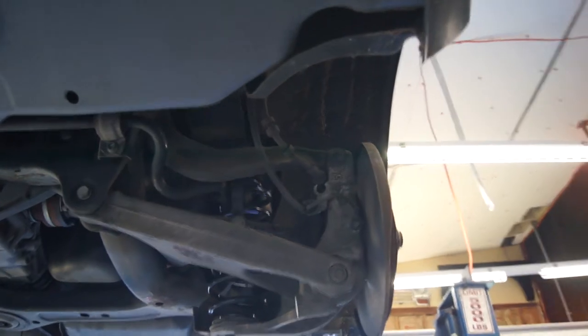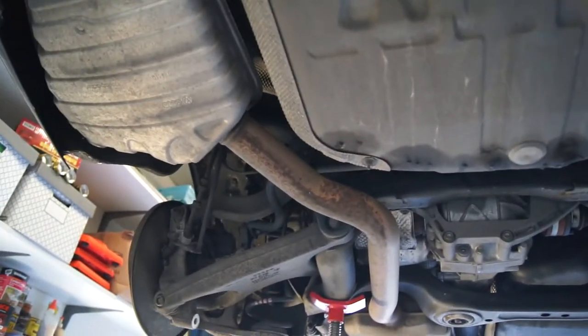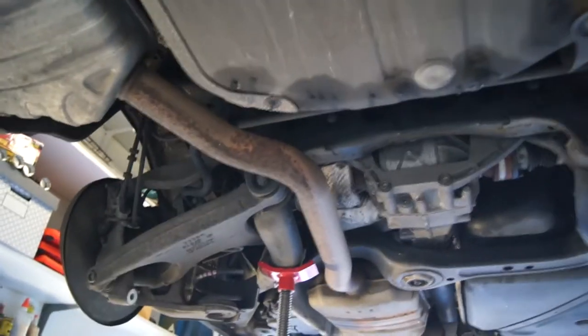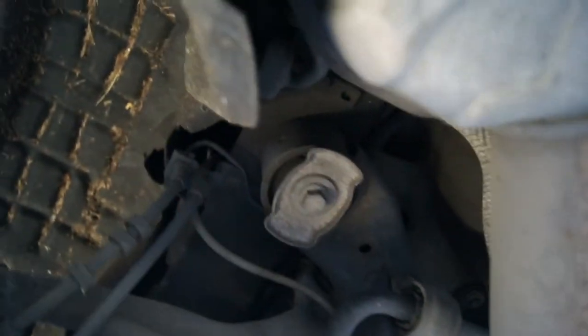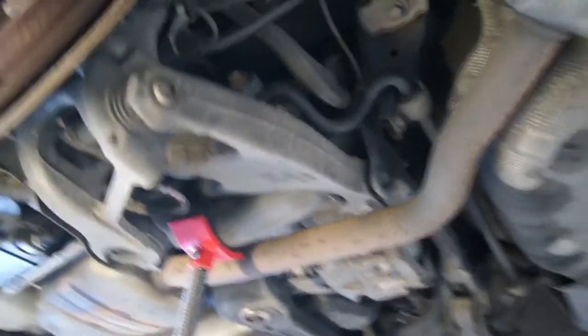I got this side done with the spring. What I'm going to do now is a live action of what I had to do — relatively simple. Some other videos online show people trying to pull the springs out without doing this, but if you've got a lift or can get underneath safely, this is the way to go. I had to pull this bolt out — this guy — and this one, which I think are 16s. This one's an 18 and takes a crowbar. I've got my stand underneath on the main beam. I'll take these bolts out, lower it down, pop the spring out, put the new one in, lift it back up, and put the bolts back on.